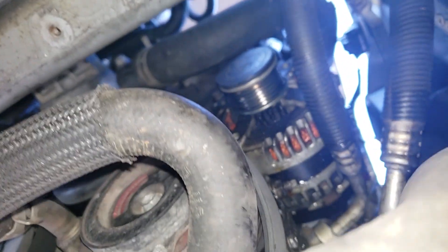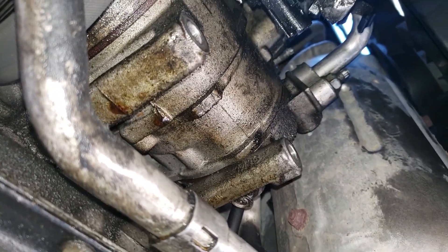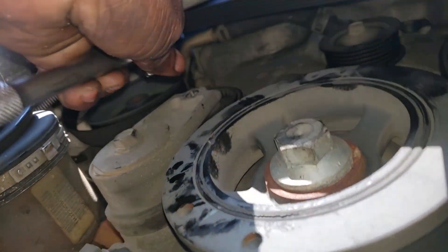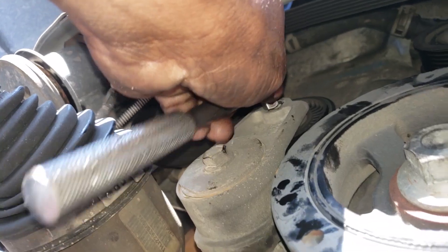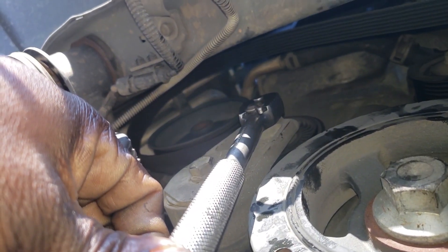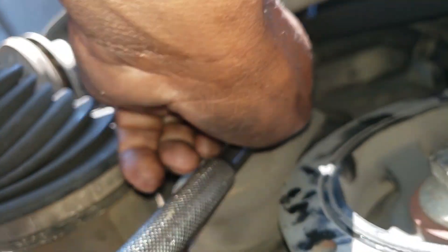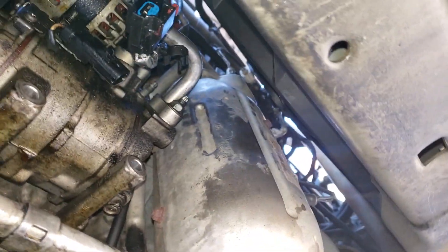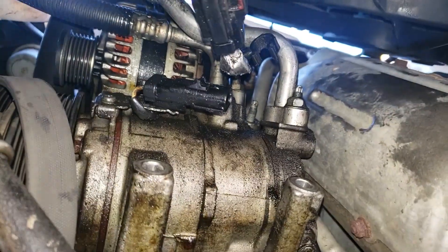The next thing is to release the belt — I forgot to do that. I realized the compressor started pulling toward the alternator. You have to release it from the tensioner: put a regular socket into the slot right there and push it. That's pretty straightforward — you'll figure it out. I'll check back as progress goes on.